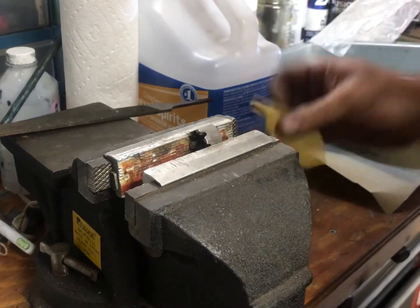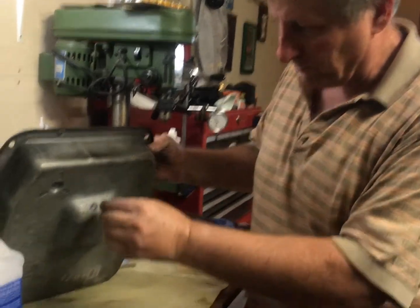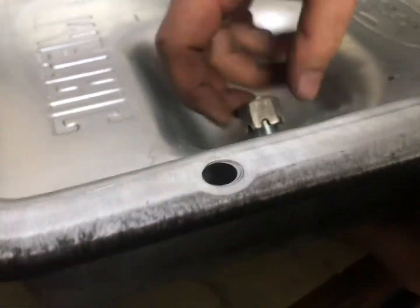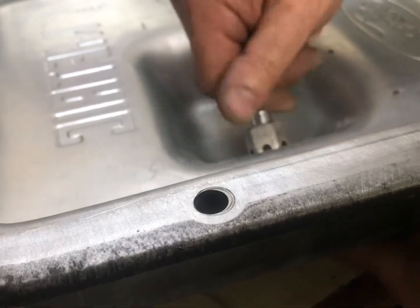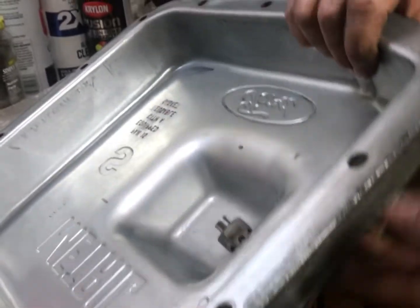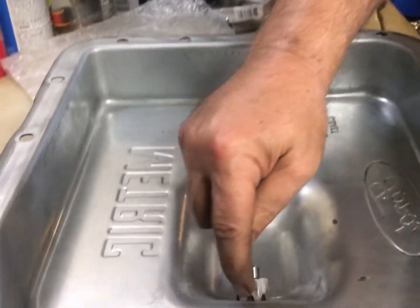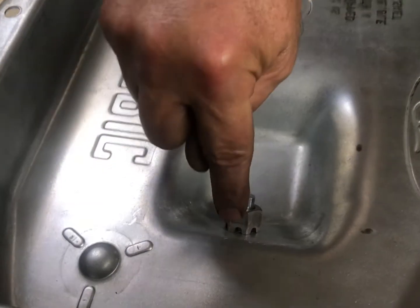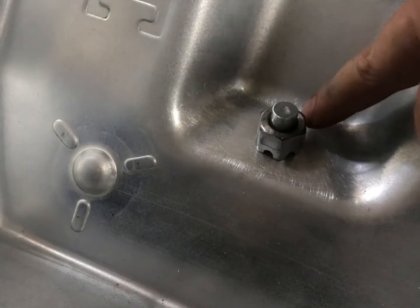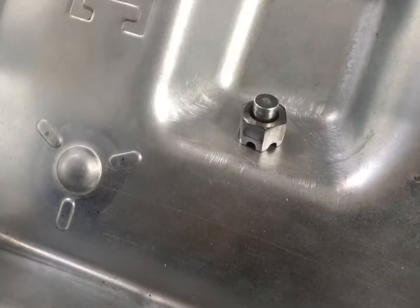Got this one buttoned up — still on the bolt without the gasket for obvious reasons because it's gonna get really hot. I'm gonna come in and stick our castle nut on just like that. The only bit of oil that's gonna remain when you drain is just that little puddle that stays right in here. We're gonna snug this down so the castle nut fits good and snug against the pan, then come in and just hit it in three or four spots with the welder. It's gonna be a little tricky down here on the bottom, but I just need one, two, three and I'm good.